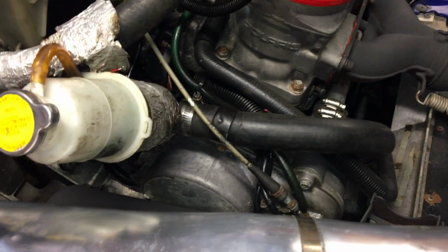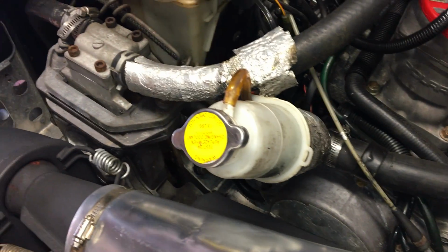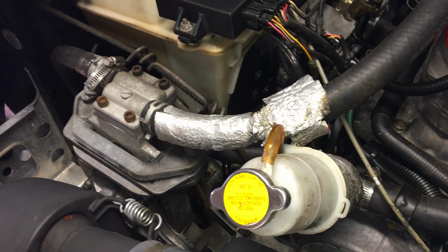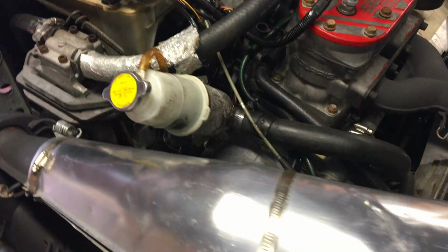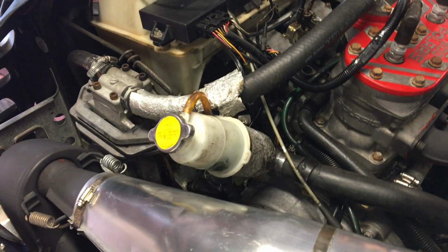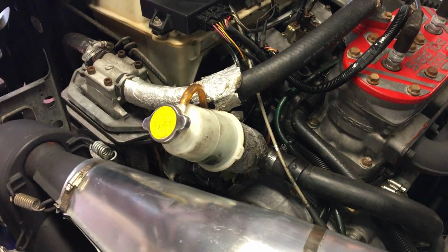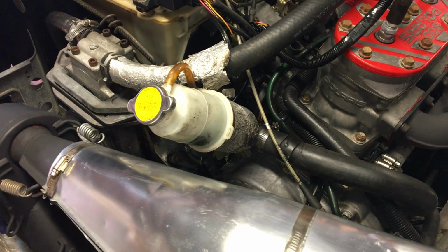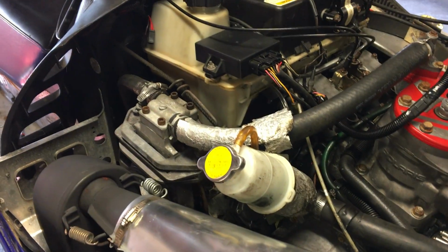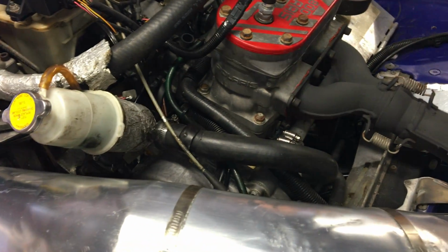But for Polaris to do that, they realize that recoil rope is going to break quite often because of the amount of compression that this thing is pushing. So what we're going to do is we're going to essentially order a recoil rope called Amsteel Blue. You know what it is? It's actually a synthetic winch rope, and it's rated for 5,000 pounds. And so we're gonna do that, just because we don't want to worry about that issue ever again.